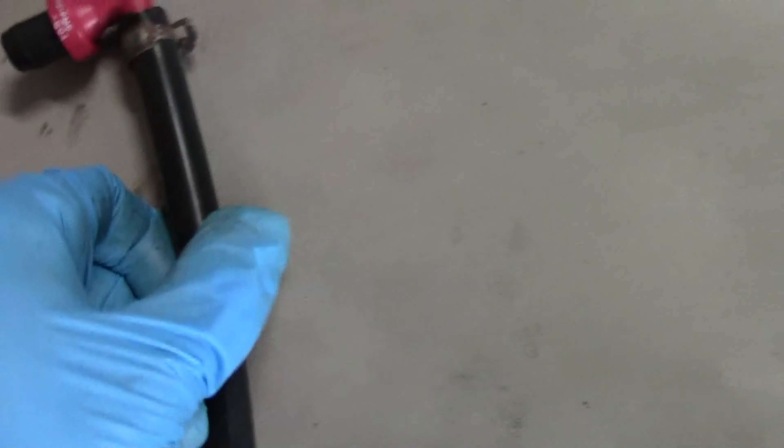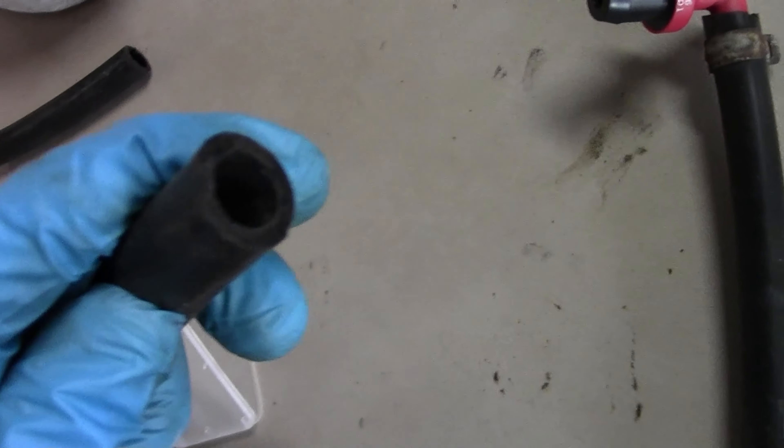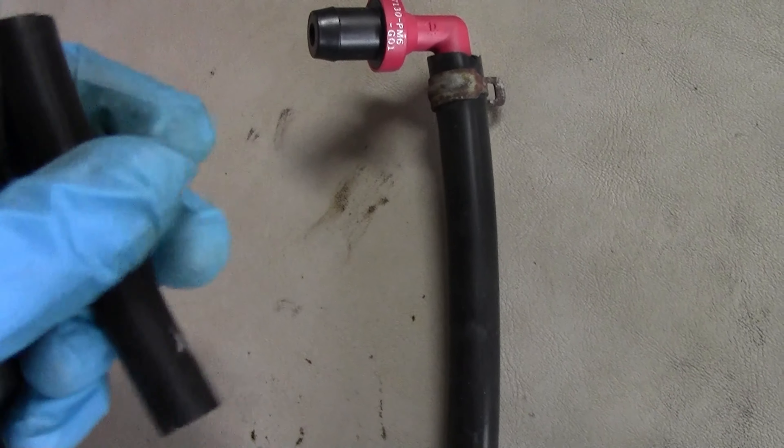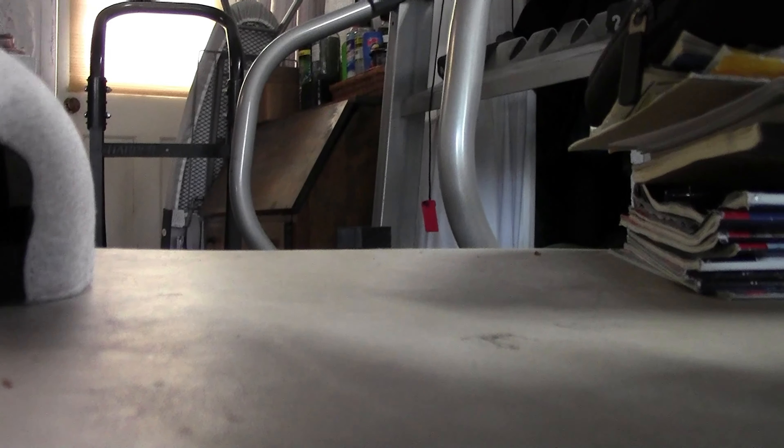I thought this piece was going to be extremely easy. We've got a new hose on this end, but the bottom is big and only fits this size hose, while the little guy we replaced going into the oil separator fits a smaller size hose. So we don't have an OEM step-down hose. What we're doing is letting the smaller one slip into here and giving it a good shove — that's going to be our step-down solution.